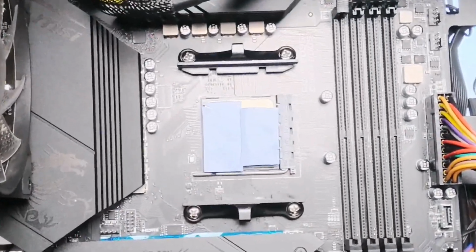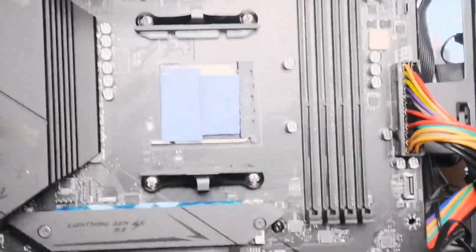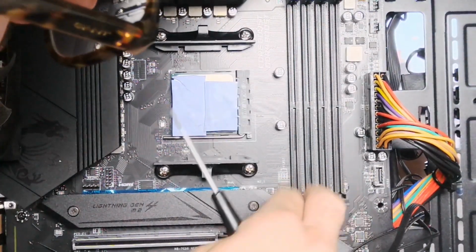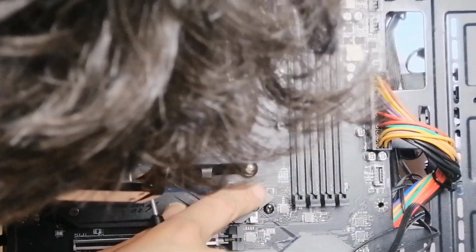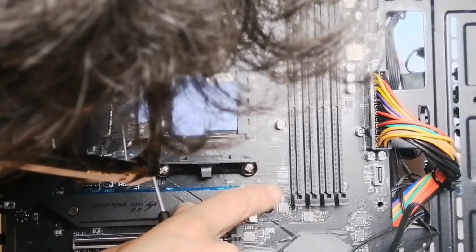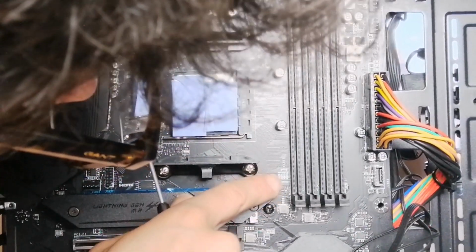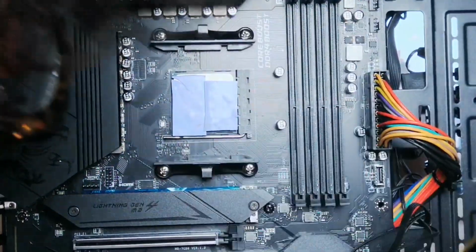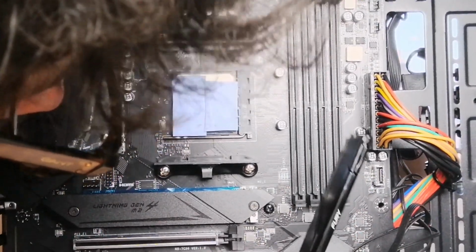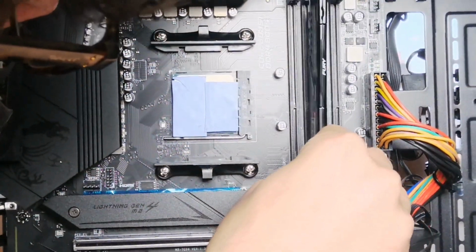I'm going to put in my RAM memory now. On here it says, RAM memory tells me here, right, it's marks on there. It says 2 and 1 and 1. So on here it's DIMM A1, DIMM A2, DIMM B1, and DIMM B2. So they're in pairs. So it says here the first ones are DIMM A2, DIMM B2. So that would be like this.